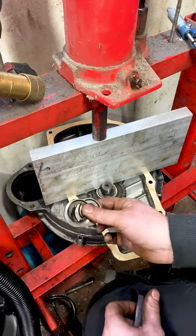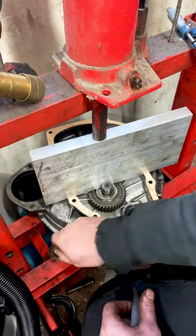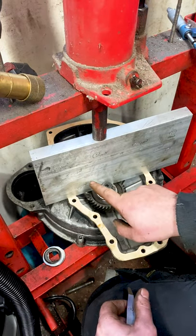I didn't arrive at this easily — I've changed out a few different primary gear thrust washers until I got the right clearance. The other way to do this is with the engine off the gearbox: you bolt the gearbox on and check this clearance off of the gearbox.